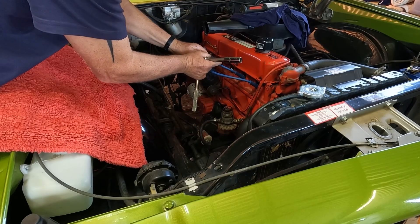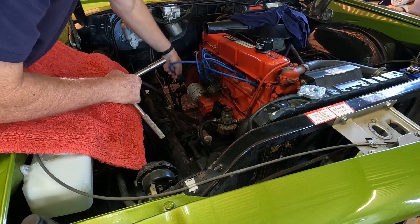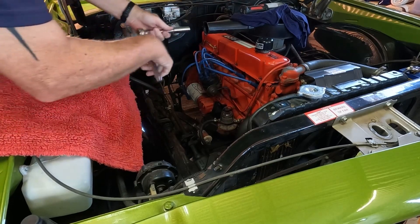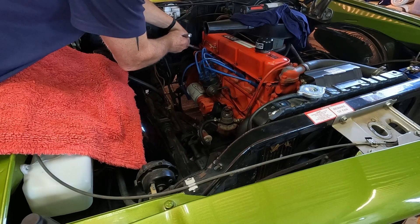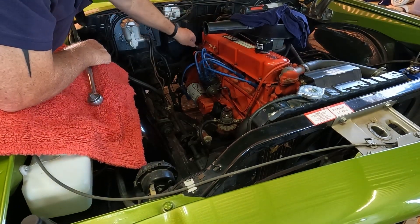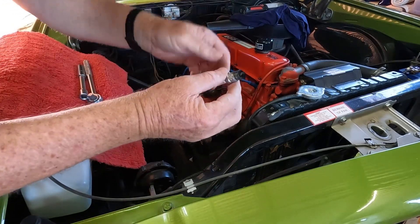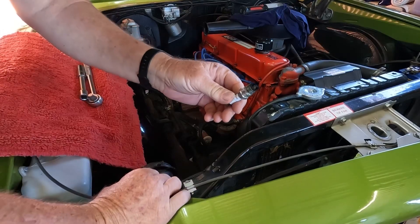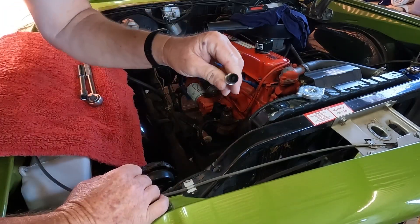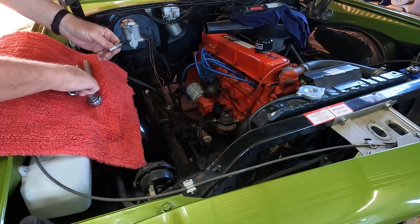Just make sure that fits on properly. Let's do one more - check again, it's all good. Here's the last one. It's pretty much the same - it's got the brown tinge on one side and it's pretty much blacked on the top, the sooty sort of colour. This one's quite brown down towards the bottom of the plug. We'll put that one back as is.